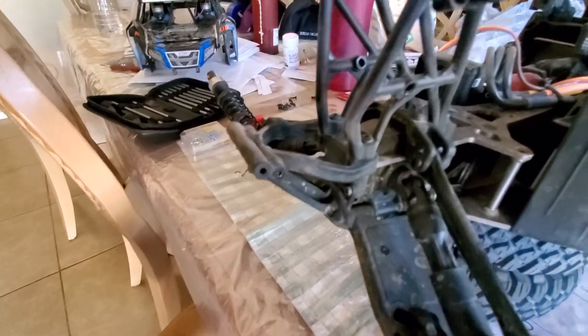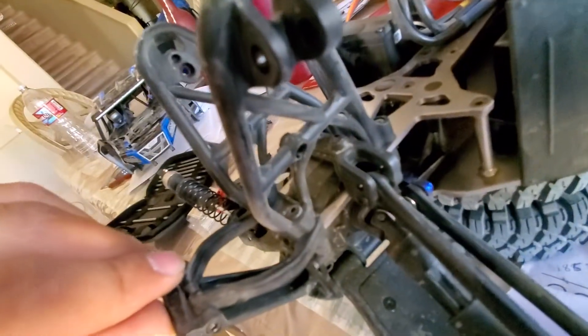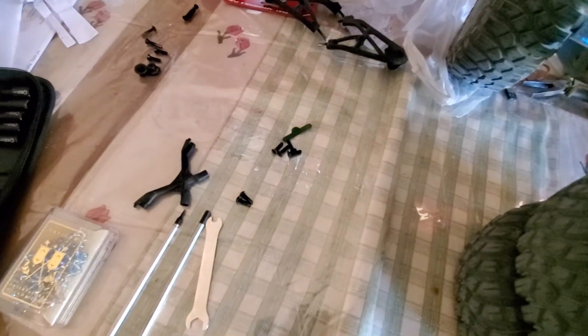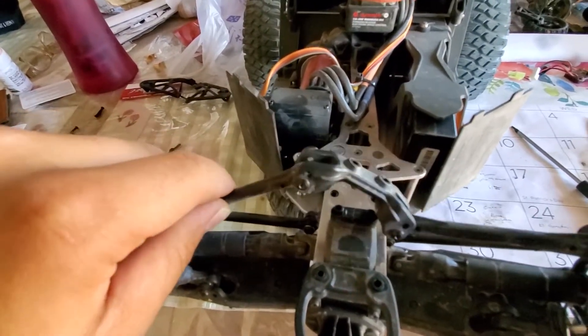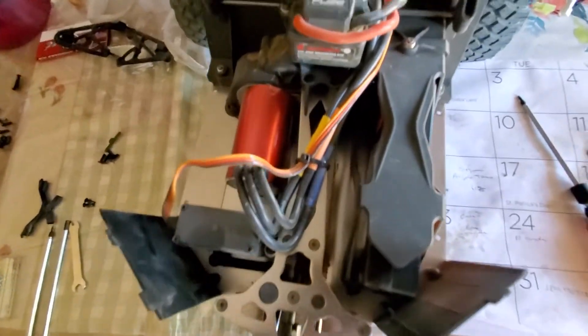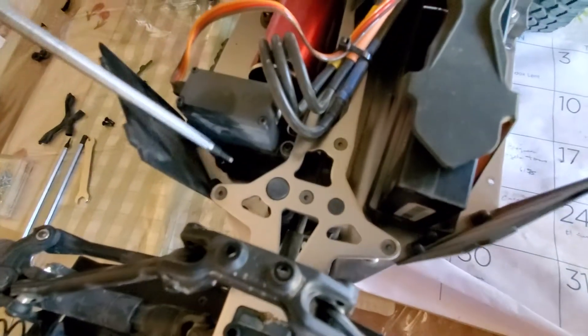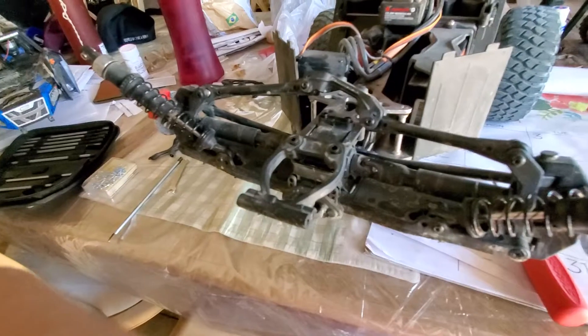In order to get to this diff we're gonna have to remove this bracket from the bumper up top. So far I've taken off those screws — four plus two. Those two top ones go on top of the differential, and then those four other ones from here you're gonna want to take off.